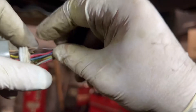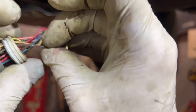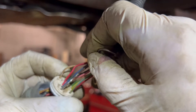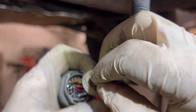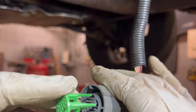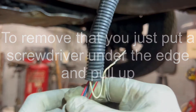I bought the harness from Amazon that does this for you - that's what I get for being lazy. The wires were just stuck together, not melted. Pull it out - you're going next to the blue. Pull it out and go next to the blue, and back in. You're also going next to the blue down there, so follow it right into the hole and make sure it locks. Once it's locked in, put this piece back in because it holds all those little clips from going back out.